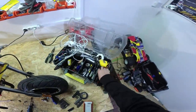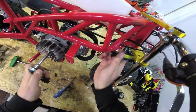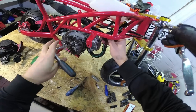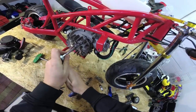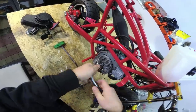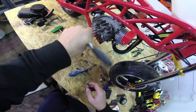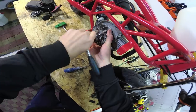What I recommend is to take a screwdriver and place it through the hole here, turn it slowly until it locks. Now you can see it locks, and now you can unscrew the bolt — as you can see it is moving. Now we can remove the screwdriver and remove the bolt.